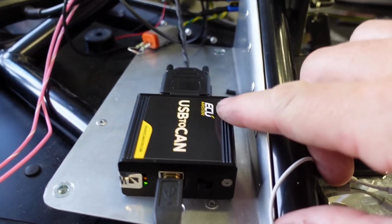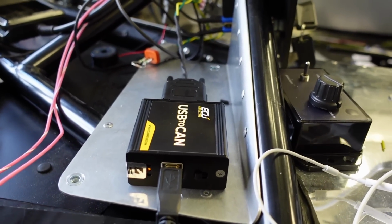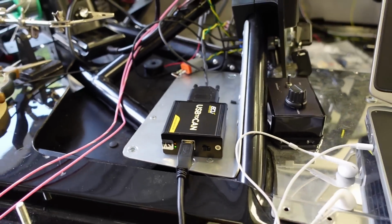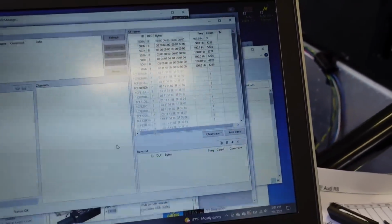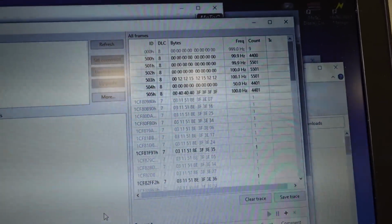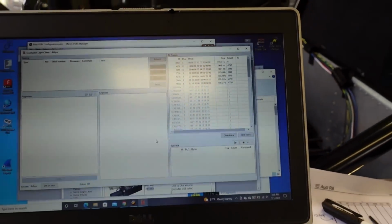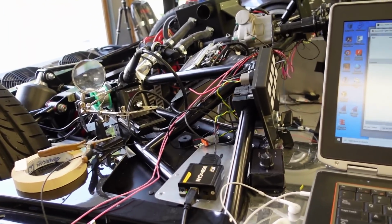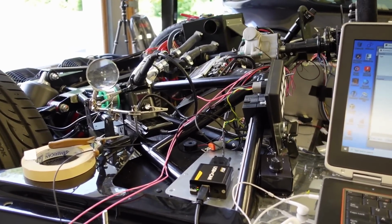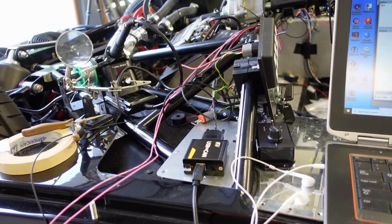And then I looked at ECUMaster's website. They said the same thing. Their device only supports their devices. MoTeC devices only support MoTeC devices. So that's another $300 part I gotta order, and then we'll get this running. But clearly it does show the CAN bus is streaming data, which is at least confirmation that the CAN bus is working. So anyway, we'll get started on some additional wiring, and I'll get that MoTeC UTC adapter, and we should be good to go.